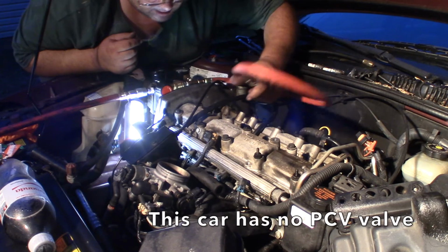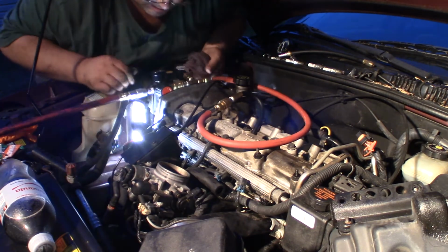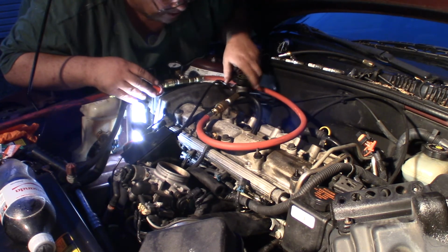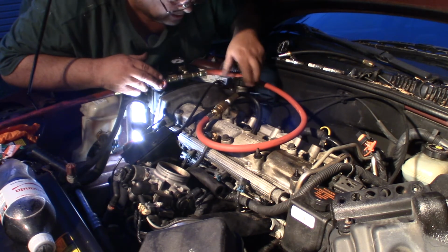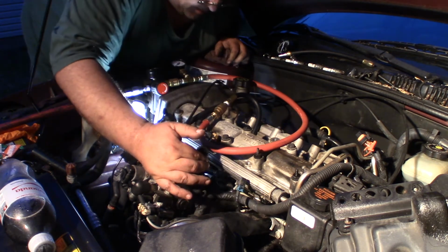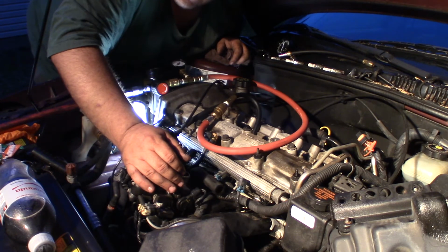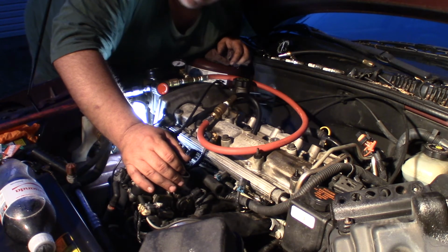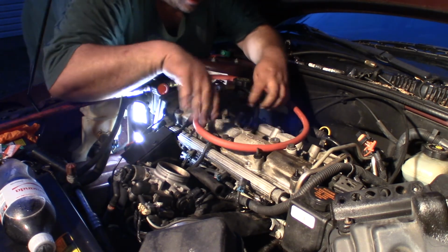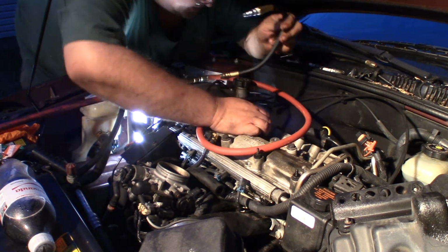Okay, that would indicate rings. Go ahead and turn this down. Yeah, I didn't hear anything coming from the exhaust, nothing coming out the intake, but it's coming out this PCV hose. And I can hear it under the oil cap a little. It's the crankcase. Oh, it's the bottom end. So what I'm going to do, squirt a little oil down in this cylinder, run another compression test on it, and see if that compression comes up all of a sudden.